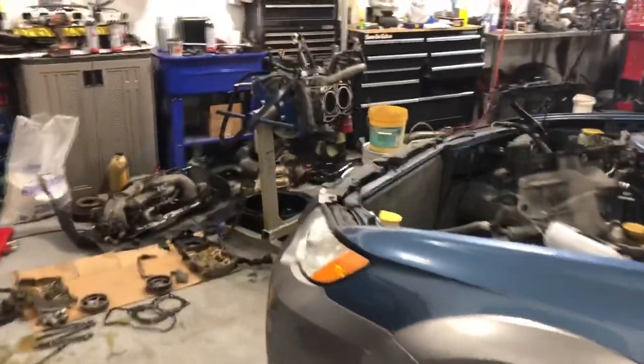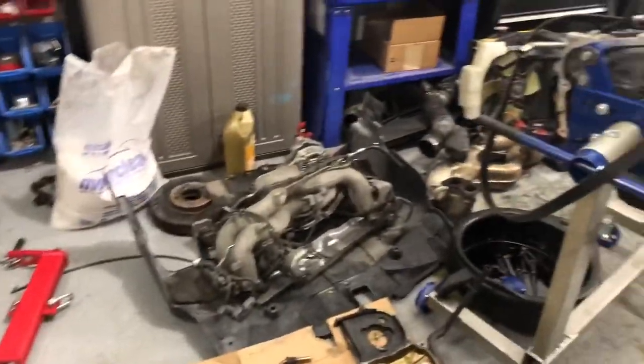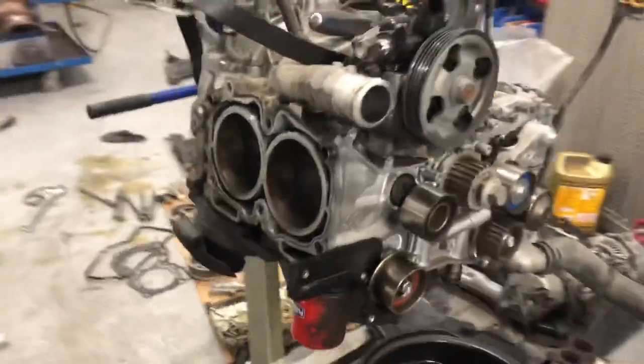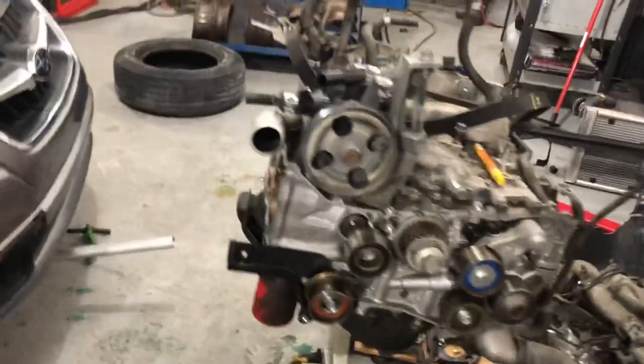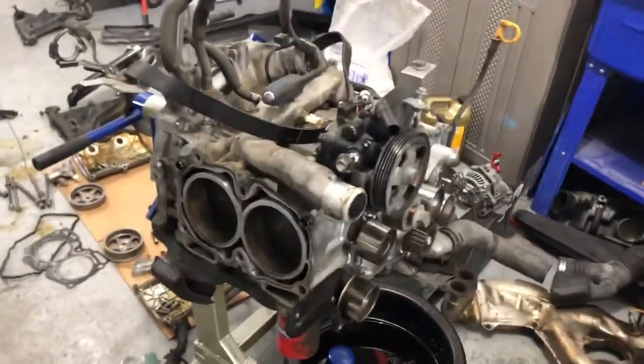This thing is super wrapped back, obviously, but Cordell broke this down yesterday, completely broke it down, and of course, you can guess what we're doing with Subaru. Head gaskets. So heads are down there at PMI in Jeff City. I dropped them off as I picked up the Camaro heads, but yeah, this thing's getting timing belt, water pump, all that good jazz too at the same time. Cylinders still look in good shape. It doesn't look like we had any ringland failure, which is a plus.